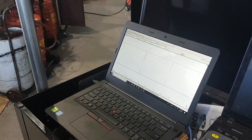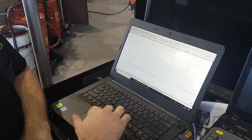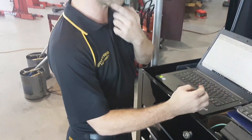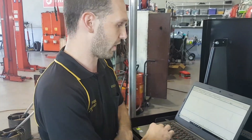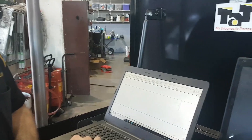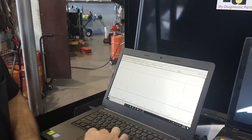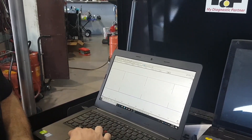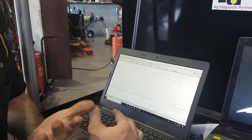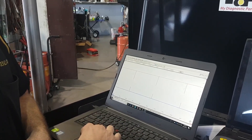Okay, so that's ignition on and we can see we're getting some control there. If we look in the scan tool, it's going to be saying that operation is at 99% — so it's basically turning it on, trying to command 99%. But you can see the red line: we go from 12 volts and then it pulls it down, but it's only pulling it down to about 3 volts or so. During that time, our blue trace has gone up to almost 3 amps, and it decides it doesn't like that — it's raised amperage too quickly, something must be going on. So it aborts and doesn't even pull it all the way to ground.